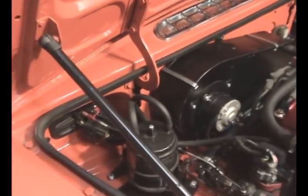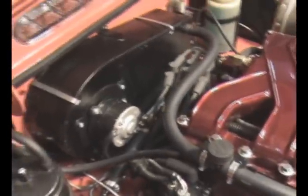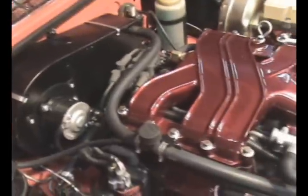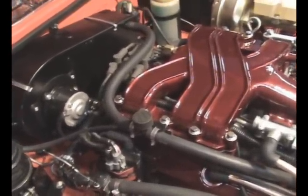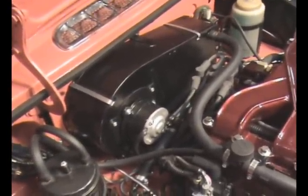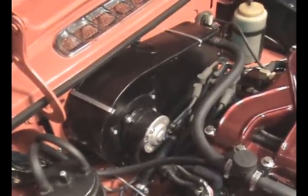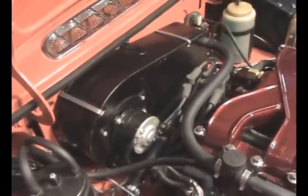Connectors — punched them through the rubber plug, kind of hidden, nice clean layout. Water plumbing for the heater has been completely revamped, a little cleaner installation. Flush plug added to the hose line going into the heater. You can also see I've used the MGOC uprated two-speed electric fan in the heater box that's been pulled and reinstalled.